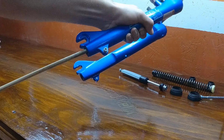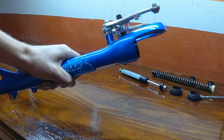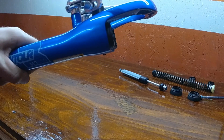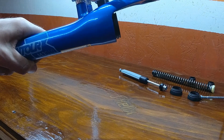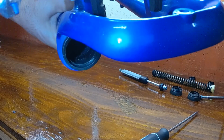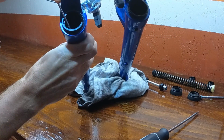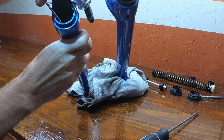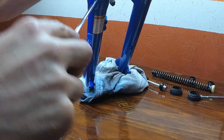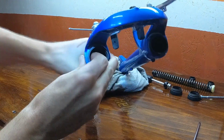So now that we kind of know what we're doing, in practice it looks like this. We take the wooden dowel and we're going to just tap a couple times on the bottom of that sleeve. And you'll notice here that we have about a 2mm gap, just a little bit of clearance, that's all that you need. Don't tap any more than that. And now we're going to identify where the retaining tab is, right there. And this is where things become a little bit tricky. You need some dexterity to do this. With one hand, you're going to want to gently pry up that tab with one screwdriver. And once it's pried upwards, use a second screwdriver to just push under the lip, that 2mm gap. Just lift it up and the sleeve will just slip right out of there.